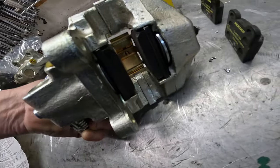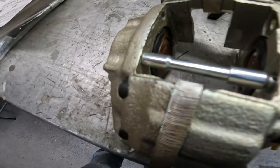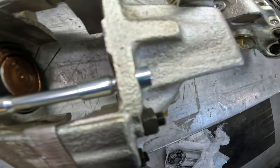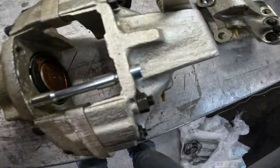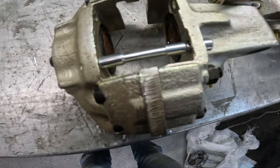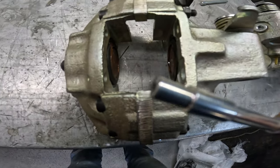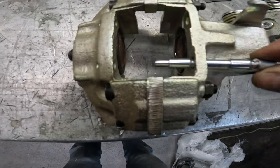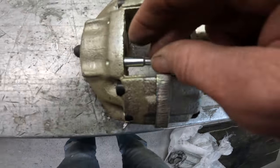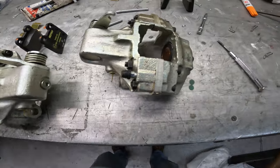They're loaded up in here just fine right now. I think I've skinned the cat on this one — I figured it out. What I'm trying to do is — you see that little bitty hole right there where the pin goes through to hold these things from backing out? Because of this adjustment right here, I think they're just a little bit off. So what I've done here is just on this tip right here, I got a little bitty piece off — I need like a half a millimeter, and then that pin hole, when it goes through, it'll be visible. This is some backyard North Carolina engineering. If I'm doing this wrong, sorry, don't follow what I'm doing, but I've got to get these brakes on.